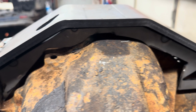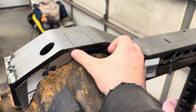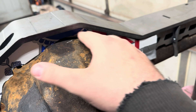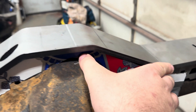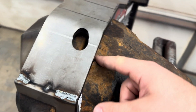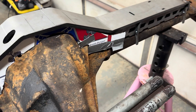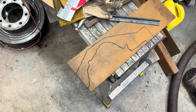You can really tell it's not right — the castings have changed a lot over the years. So I made this little template up and that's how I'm going to fix that. A little more CAD — cardboard-aided design, this time out of a PBR box. This'll fit a lot better, get a lot more weld on, and work out pretty good. You can see this is sitting on top of the breather now — what I'm going to do is push it all the way in until this rib is here, weld it a little bit deeper in so I have full access to the breather still. I traced this template out onto a piece of steel, so I'm about to get the plasma cutter fired up and start cutting.